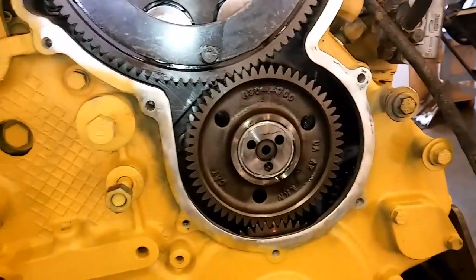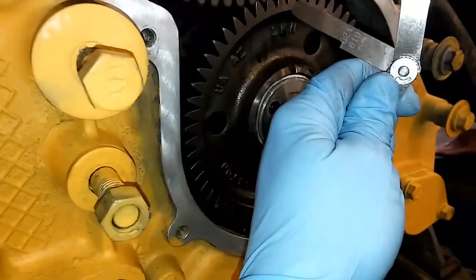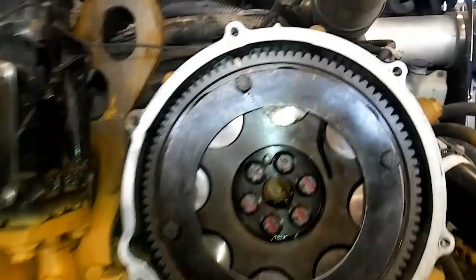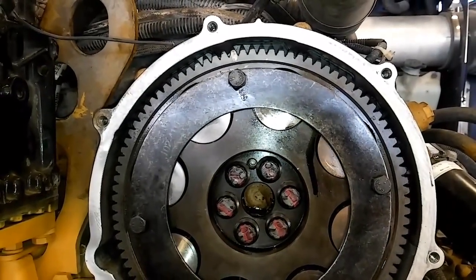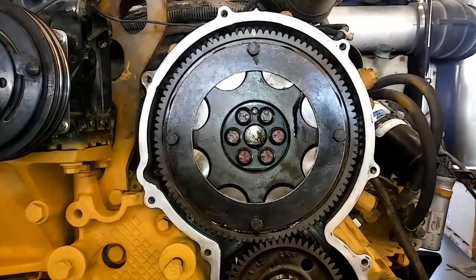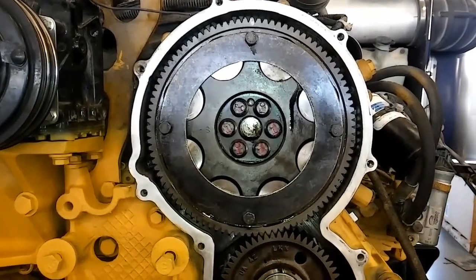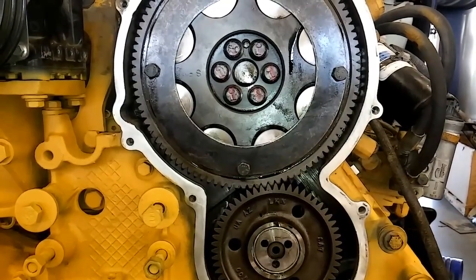It should have a little bit of free play. At this point you can try your feeler gauge trick — if it's at 14 thousandths and the 24 thousandths doesn't fit, go ahead and install your retaining plate. Now I like to rotate the engine around two rotations — so one cam gear rotation — and what this is checking for is that the cam gear is timed properly when it pins. As long as your cam gear is timed properly and your backlash is correct, you should be good to go.